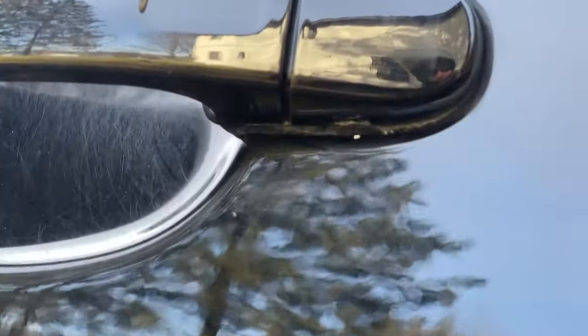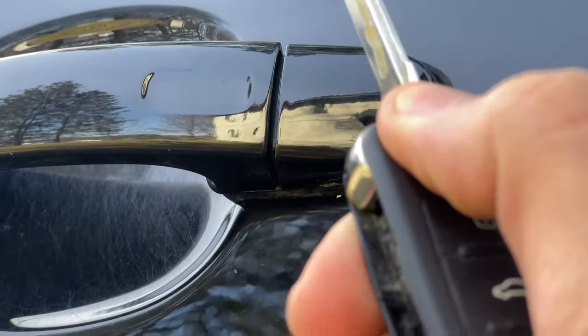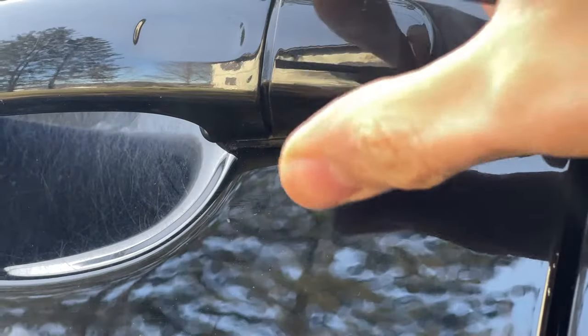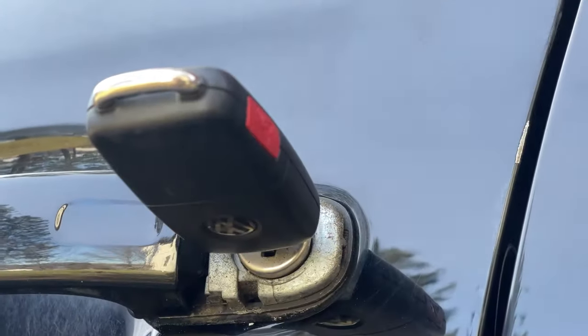To lock or unlock the car, open the key and look under your driver door's handle. You're looking for this little rectangular hole. Then what you're going to want to do is open the key, stick it into that rectangular spot, and then twist the key to pry and pop off this little plastic piece right here. This allows you to use your key to freely lock and unlock your car.